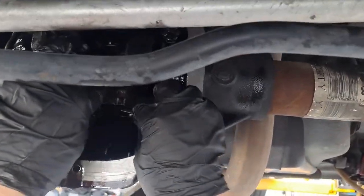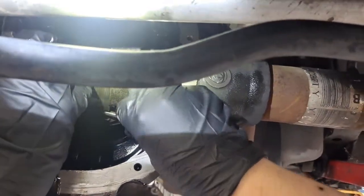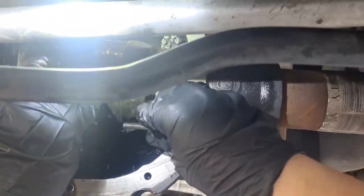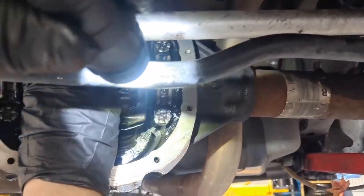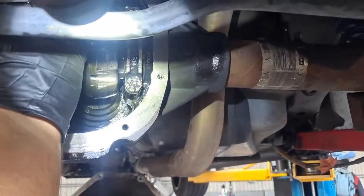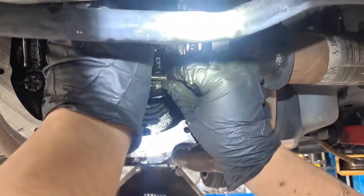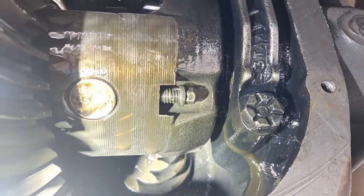And the light doesn't really help. It helps a little. Yep, just move the big pinion pin. No, it's hitting on this. Oh, so we gotta get it turned a little? There's a certain angle. We gotta get turned a little more or a little less. Just be careful turning by that. If possible, better to turn it by the pinion, but it's alright. Okay, stop right there. So we're just gonna get Loctite on the threads of that bolt. Man, it's tough to get it to focus though. There we go. Slow pop. Just blob it right on the threads, just a little blob.